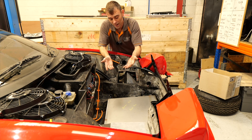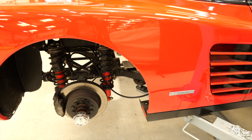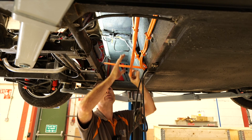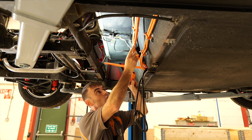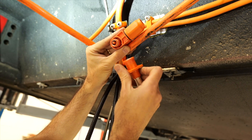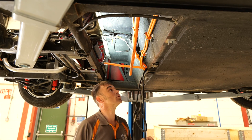But before we do that, I want to show you the battery pack that goes in where the original petrol tanks went. Let's get the car up on the lift and get underneath. This is the void I was talking about where the old petrol tanks used to go. The electrical guys have already been busy starting to do the high voltage routing — most of those cables are already routed throughout the car. And where you've got cables hanging down, this is where we're going to join the high voltage system into the battery boxes. Essentially, once cut to length, there'll be a plug on the cable and a matching socket on the battery pack, so when it's lifted in, all the guys need to do is plug it on and job done. So, glamorous assistant time — we're going to lift this battery box into place.